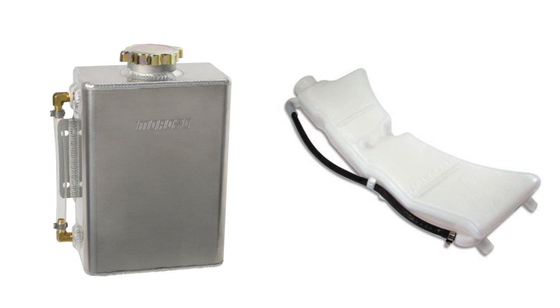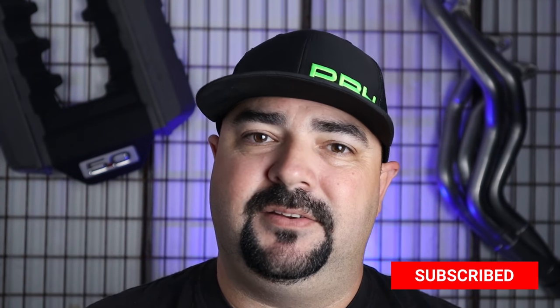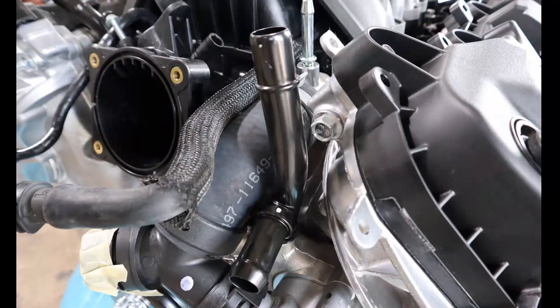In those older vehicles that have a conventional pressure relief cap with a catch can, you don't need the D-gas bottle, and if you don't have to put it in the car it's just going to clean up the engine bay that much more. So the easy simple solution is just remove the D-gas bottle — but you end up with a bunch of ports on the engine and a bunch of hoses that you're not going to be using, and in some cases you're fairly confused about what to do with those ports and how to seal them off or omit them altogether.